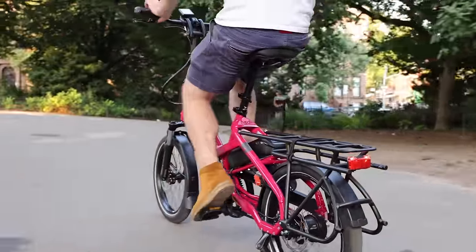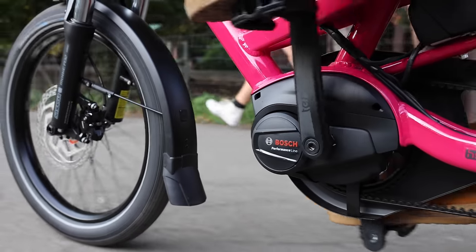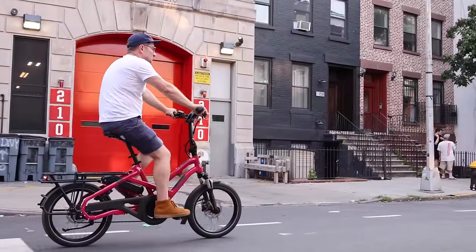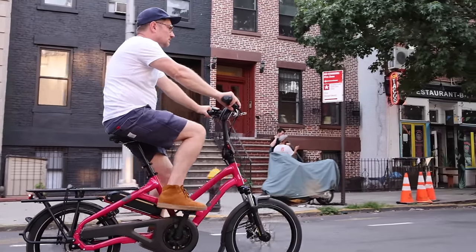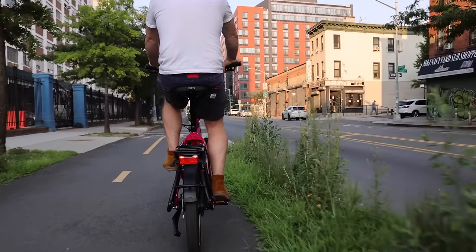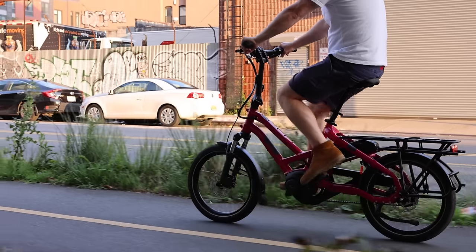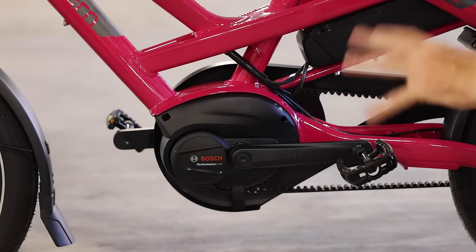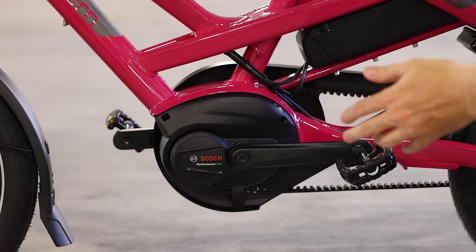Checking out the other side, you can get a better peek at the motor — it's pretty compact and pretty lightweight. One of the nice things about the Performance Line motor is it's very quiet, which I find in riding this as well. You really don't hear the motor as much as you do with the CX or Speed motor. It puts out 75 Newton meters of torque — really plenty of power. The Bosch system works with pedal assist technology, basically assisting you as you pedal. You can operate it like a normal non-electric bike, but once you activate the system you get anywhere from 60% on the lowest assistance level to upwards of 340% on the highest — so one pedal revolution and the motor is effectively giving you 3.4 times on top of that.